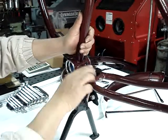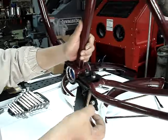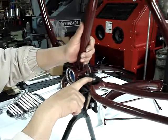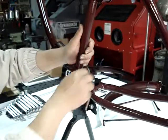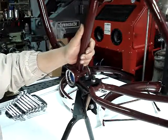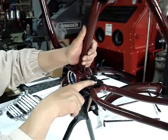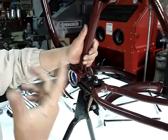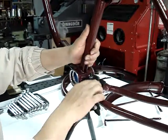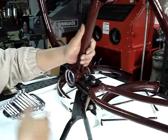In order to make these two bolts fixed, you can put another nut on top of this nut to seal it. Later we will show you how to do it. When you ride the bike on the road, there is some vibration from the engine that can make this nut loose. So the best way is to put another nut over this nut and tighten the upper nut as tight as possible to resist the vibration.